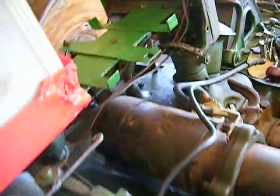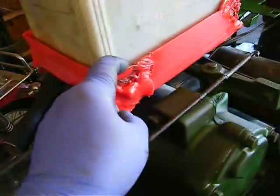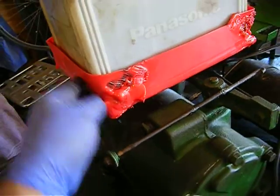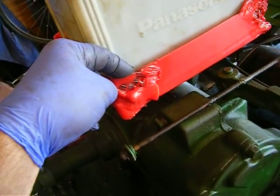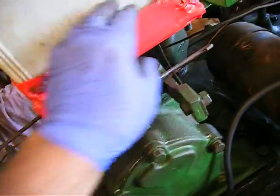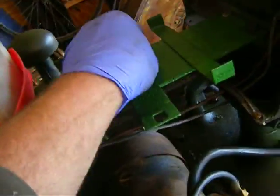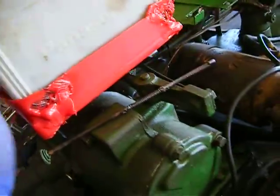We've got our gauges in. I'll probably do some wiring next. I built me a battery tray — now this looks like dog crap, but it works quite nicely. It's that rubber-made tray I had, and essentially I just heated it up with my torch and then bent the sides. I just took a pair of vice grips, got it good and hot, clipped it together like that, sprayed a little water on it, put it back together. Anything that will keep that battery from chafing will be fine. I'm not worried about aesthetics because you're not going to see it.